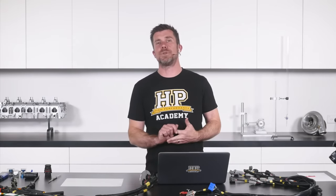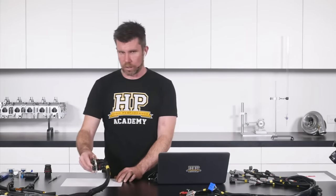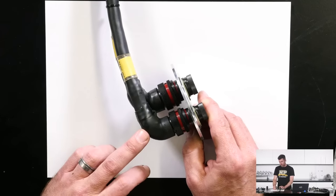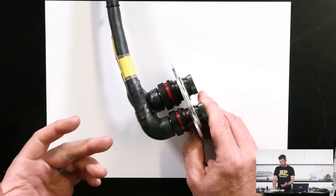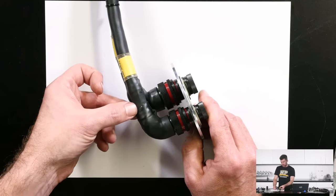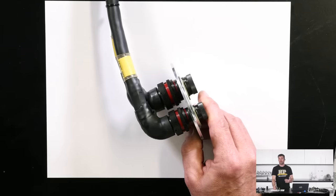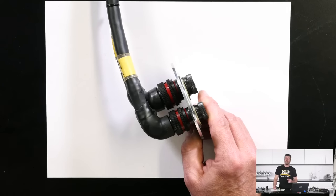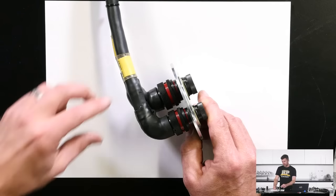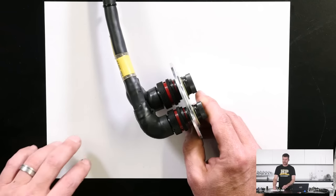Moving on to boots used for professional motorsport wiring harnesses. Under the overhead camera we can see a Raychem heat-moulded boot on the back of an Autosport connector on our bulkhead. This heat-recoverable boot is placed over the connector once everything is terminated, then recovered down onto the Autosport connector using a heat gun, and recovered down onto our DR25 at the other end. It's sealed at both ends with a Resintec epoxy resin, providing environmental protection from moisture and dust ingress. Because it becomes a rigid boot once shrunk down, it also provides strain relief so harness movement is not transferred into the terminals inside the connector.